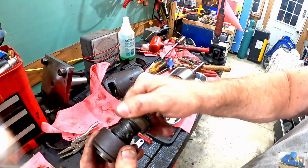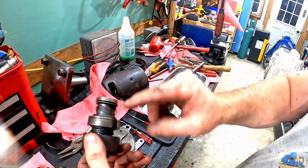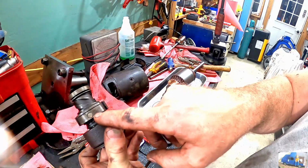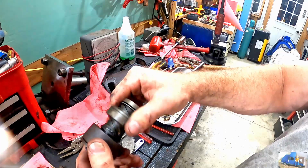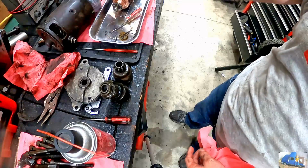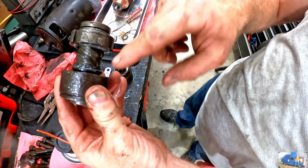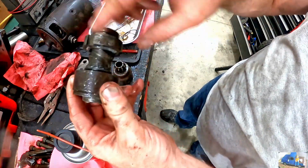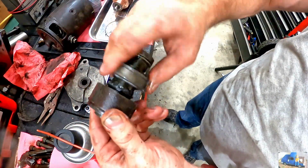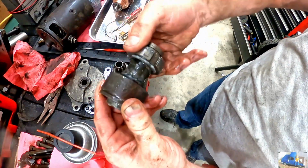Pops in a detent down here and then rotates all the way up. It never did this before. We were fighting with it. So I think what's happening is one of these pieces were out of position or half falling out of the bore and not aligned properly, or there was just some massive junk in there. Put a little white lithium lube on this guy. Tried to work it into the gaps in the shaft on the top, in between there. And obviously got it on the scroll here, and this thing is just moving like butter. Working really nice. That's what it's supposed to do.